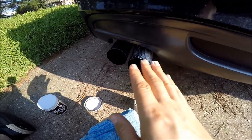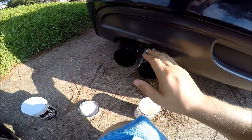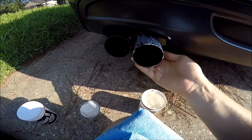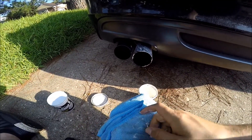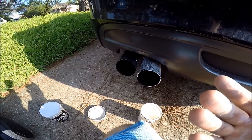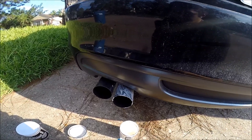The C-grade compound is a little more gritty for getting all this oxidation off. I just dip two fingers in and rub it on the exhaust tips. When polishing metal, the general rule of thumb is to go either vertical or horizontal — no big swirls or circles when doing it by hand. Machine polishing is different, but for exhaust tips your hand gives the best results since it's a nice small area. I personally like to go vertical because I feel like I cover more area that way.